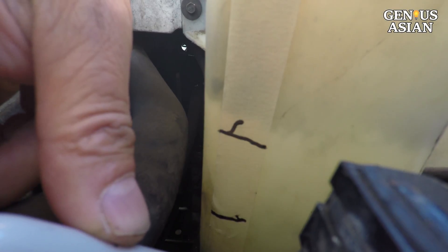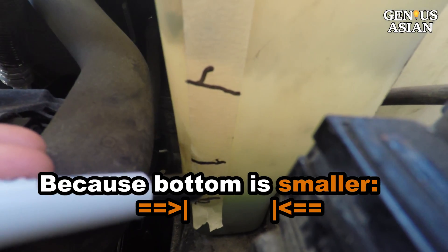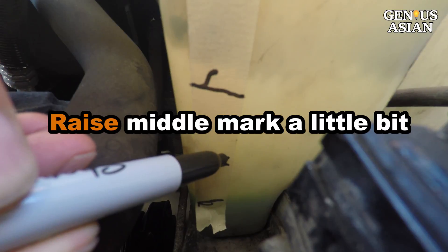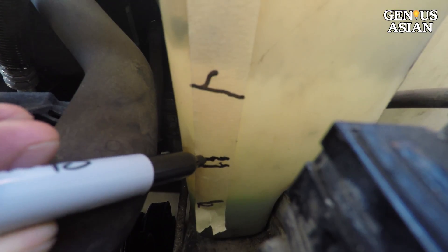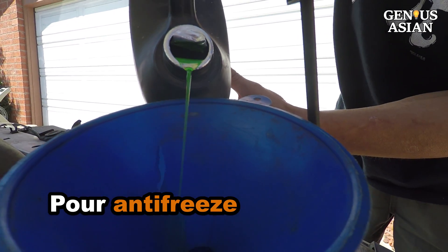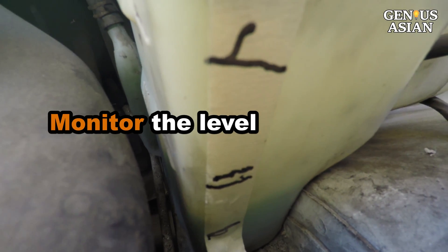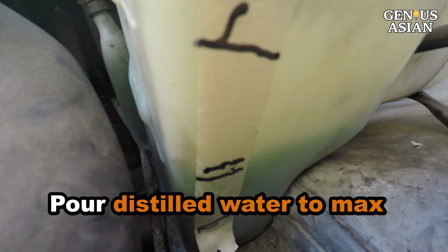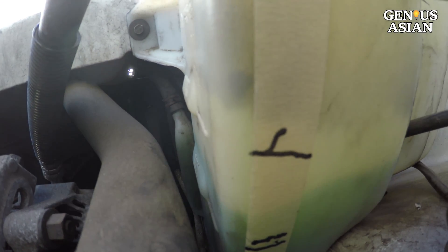The third line is at the halfway between the first two lines. Because the bottom is a little bit smaller than the top, I'm going to adjust a little bit — it's not really exact halfway, so I will set this to be a slightly higher level. Next, you pour the coolant and monitor the level, then pour the distilled water to the top max, and that makes it 50/50.